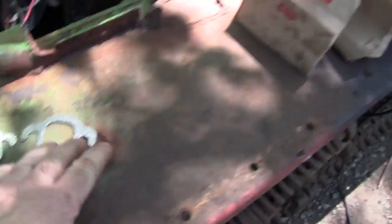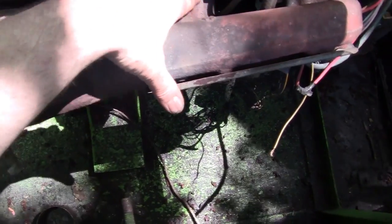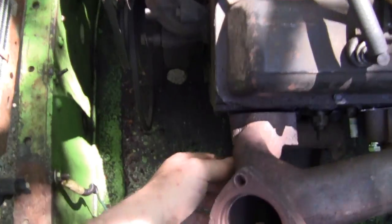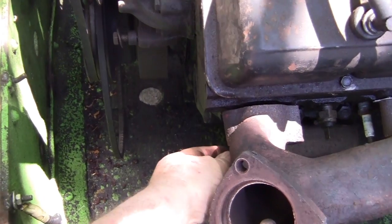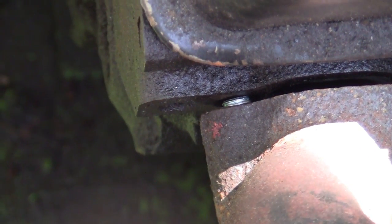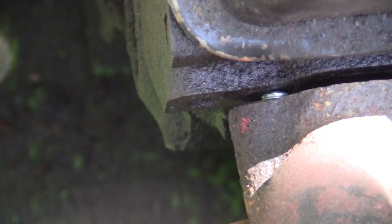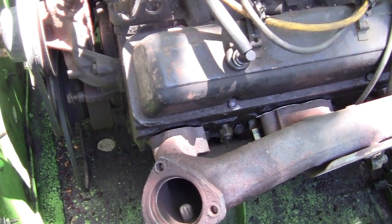I had to do a little digging to find my gaskets and bolts since it's been a month since I've worked on it. I'm just going to put my lock washers on these bolts and put my gaskets in here on these two, then I'll show you how to install that. I've got those four bolts in. I'm going to show you how much this manifold's warped — I've got a bolt stuck in the bottom. You see the hole right there? If you try to cross-thread it, we don't want to do that. You could drill the last two out but you want this to match up with the gasket perfectly. Let's go ahead and install our homemade expander tool right in there.